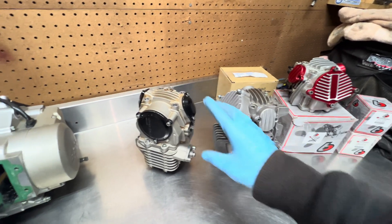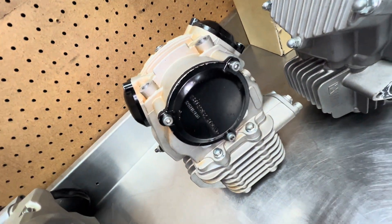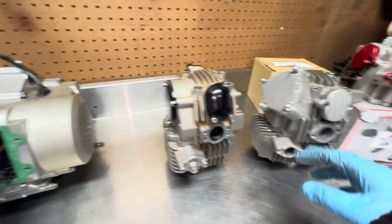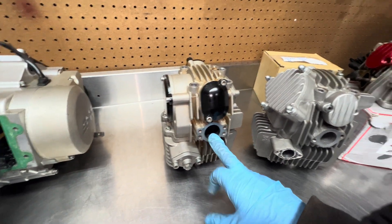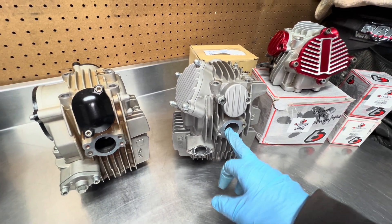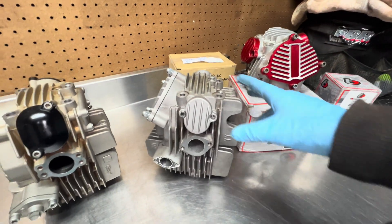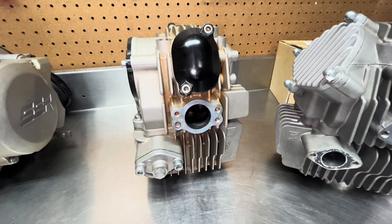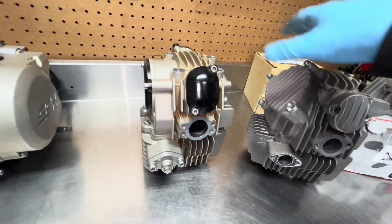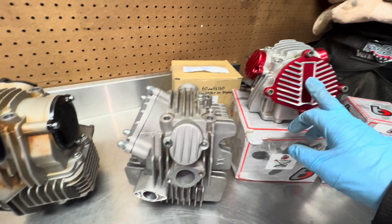Over here we got a few different options. I'd like to keep it as small bore as possible. If I went with this top end — this is off of a 170TX — it has bigger intake and exhaust ports than like the typical 150 or 160 head. This one has a 28 millimeter intake port, whereas the KLX or the CRF type one — this happens to be a Honda port and this one here is a KLX port with the bigger studs — both of these are going to be 26 millimeter intake port versus the 28. And on the exhaust port, this one here is 23 millimeter versus 21 millimeters on the others.